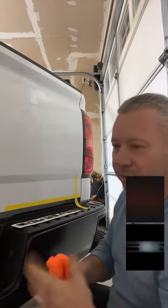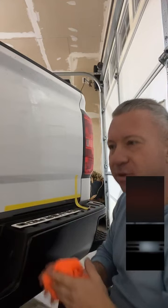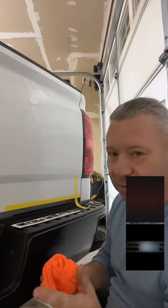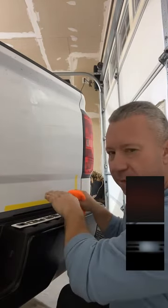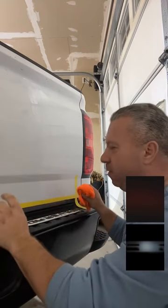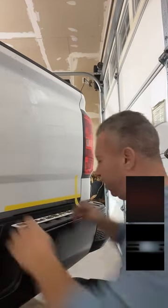The issue was on the Mustangs from that first generation, at the rear taillight, it is a slope down taillight. Right, yeah. The problem is the way they want you to align that rear graphic to the one that goes across the door, they say follow the angle of the pin. The way we ultimately solved it was we told the customer what the situation was. Like, I want these graphics. Fine. So we had to remove the taillight and file down a portion of the opening in the body to level out the taillight in order to flush mount this graphic that lines up with the door. Right. And people want to know why restoration is so expensive.